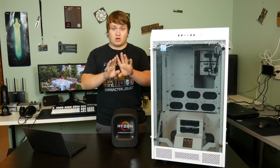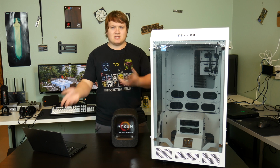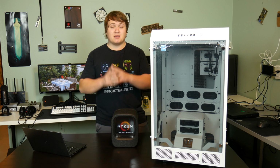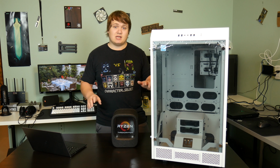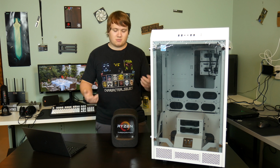And I know what some of you that really know your boards are thinking, what about the Asus Zenith Extreme? It's listed as a 10 gigabit. It comes with a PCI Express 10 gigabit adapter. It does not have 10 gigabit built into the rear I/O of the motherboard. And I want to try and save my PCI Express slots as well as my PCI Express lanes.